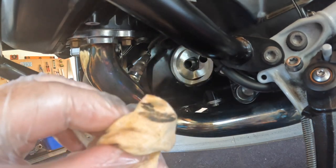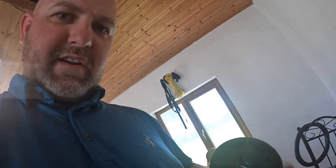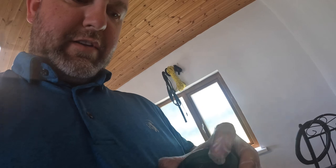The new filter I'm going to use is a K&N filter. It's got a nut on the top of it so you don't have to worry about using any sort of tool to take it off — a 17 or 18 mil nut. Before you put it on, strip off the plastic, give it a quick lick of oil around the rubber seal, and it goes on fairly lightly at about one foot pound. There are also instructions on the filter itself.